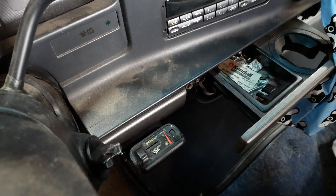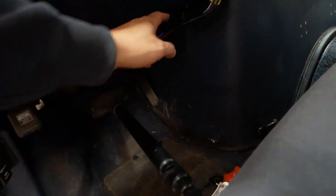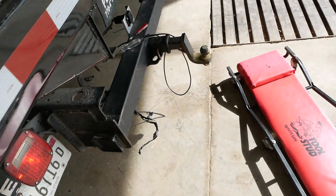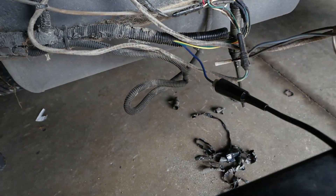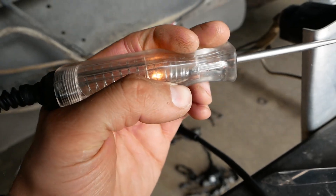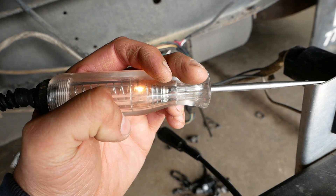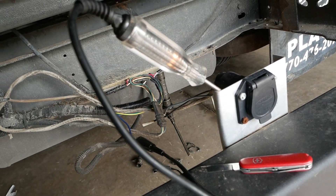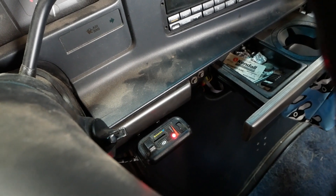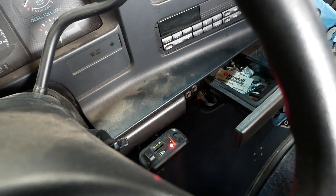That's it for the installation. The LED light might be burned out but it appears to be working. I've got the brake pedal pressed down, the wiring is tied up, and if we go to the back I'm hooked onto the dark blue wire. If I touch a test light to ground — we have something. The brake controller knows when the trailer is hooked up — it senses the resistance in that circuit. I think it's working; we've got all the wiring we need, just need to connect A to B.